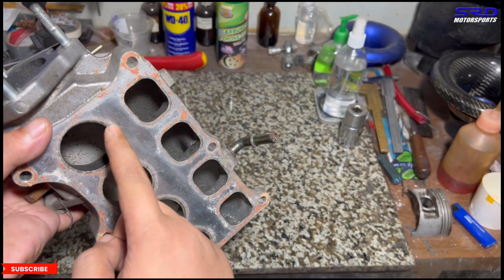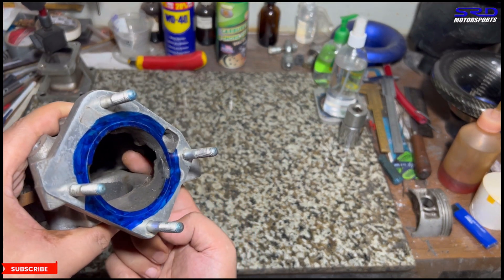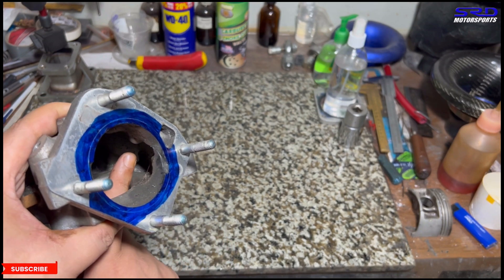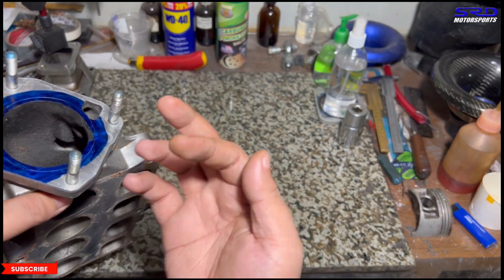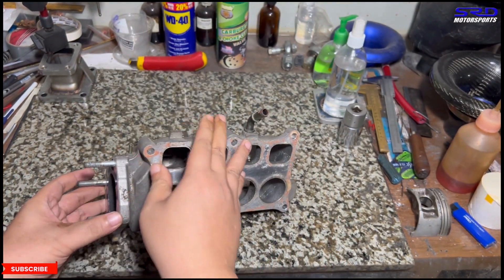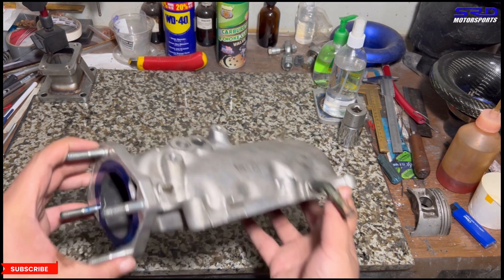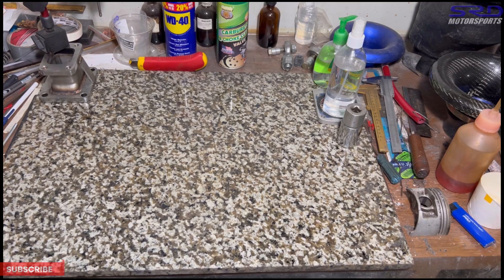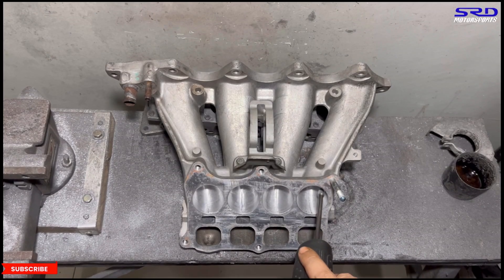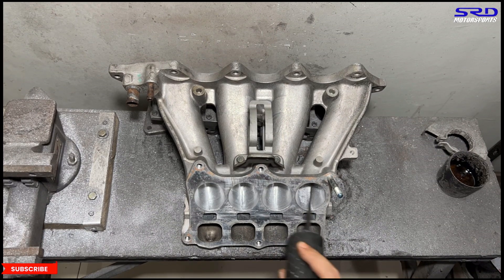Even on the long side of the runner, when the butterfly is closed, we're going to open it up — there's still carbon in it, we haven't cleaned it yet. Now we go to the porting bench for real. We go with the carbide cutter because we're trying to remove the casting flash between the merging of the core. Now let's time-lapse.